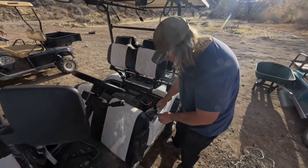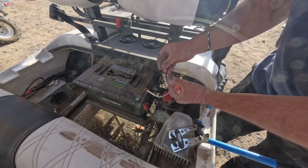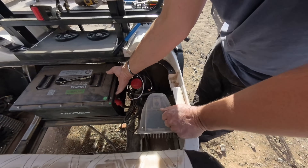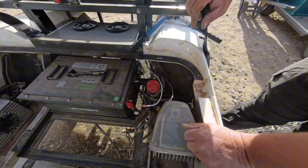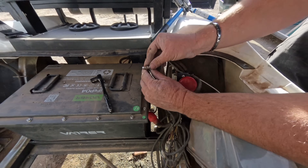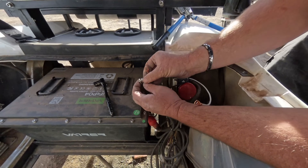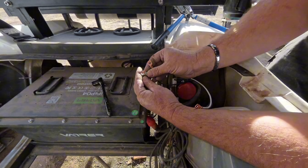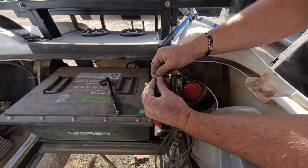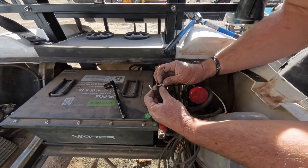We're going to crimp one on, then crimp another one. These are some pretty big connectors but they've got the right size hole. I don't have the small enough one, so what I've done is fold the wire in half and stick it in there and crimp it. We're going to turn off the battery. That's what I really like about lithium batteries — turn them off, I've got no power here. All those years of dealing with lead acid and the corrosion everywhere — it's just nice not to have all that corrosion. When you hook up the batteries, you always put the biggest draw right tight to the battery, and then the charger goes right here. After I put solar panels on the Club Car, I haven't plugged it in since. I doubt I'll ever have to plug this one in again.